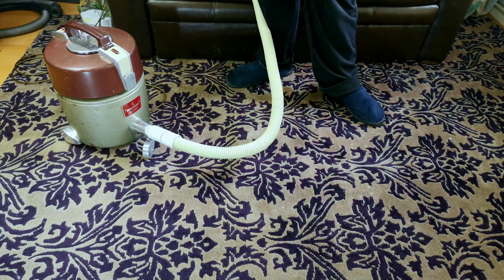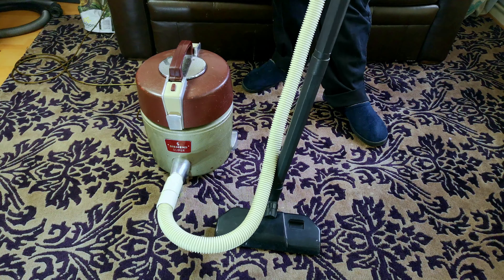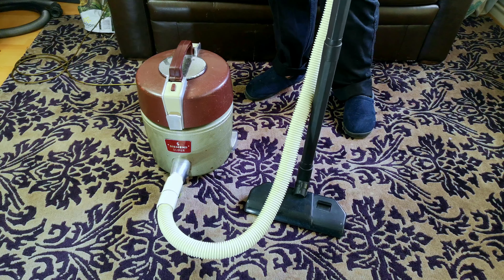I only really bought it for the bent end. I think a machine like this, with the suction it has, is probably going to need an eco floor tool — one that's going to clamp itself down and make the most of its 500 watts of fairly mediocre airflow. We'll ignore the floor head for now. Comment down below — I've never had one of these before. Is it that great or is it pretty terrible? Is there any way I can improve it? I did fit a Dyson DC25 motor to it, but it ran the wrong way — it blew out of the hose because this obviously works differently to most other motors. It works back to front; hence why all the exhaust air comes out of the fan and sucks through from the back. So I'm glad we got the original motor working. I think there might still be a few issues with the housing, but hey — it's done enough to show you it now.